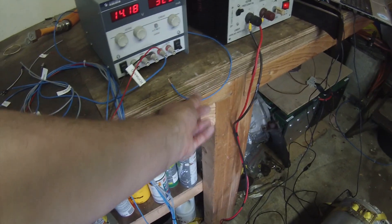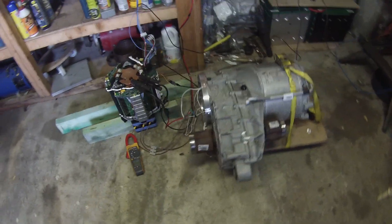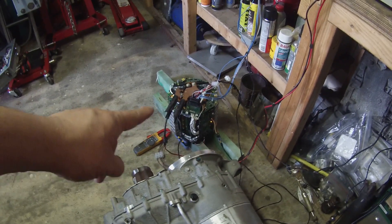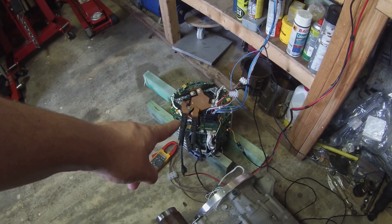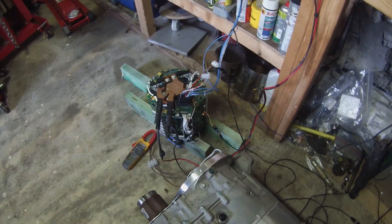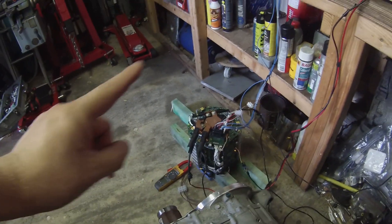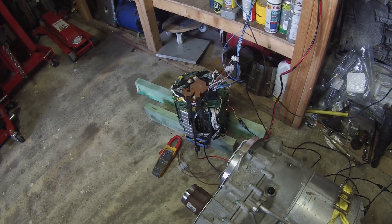CAN bus, start switch, and all that. I've got my multimeter there just measuring the phase currents. Unfortunately, because I'm using this FTDI adapter — as I explained in the last video, the wires I'd assigned in the amp seal connector for my RS232 turned out to have a capacitor connected across them, so I can't use RS232 up through the wiring loom as I had planned. We're going to have to change that pin assignment in our next revision of the PCB.